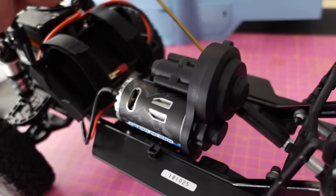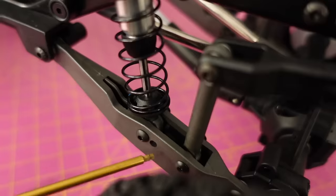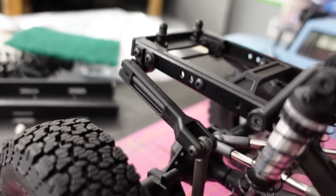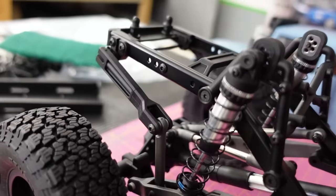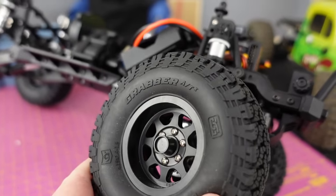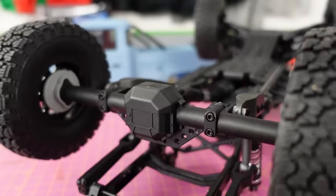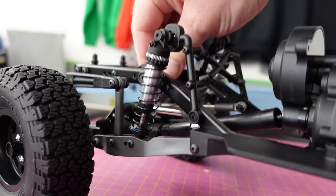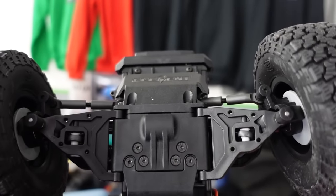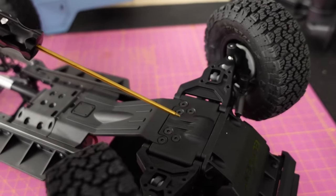You've got some small side steps here. There's your adjustable rear suspension — you've got a few different places you can put your suspension there, and a couple of different options on the trailing arms as well. And then there's your anti-roll bar or sway bar. General Grabber tyres on beadlocks. Foam's in there — compound's not super soft but still feels pretty decent. And then underneath: solid rear axle, your GKS Gatekeeper suspension, telescopic drive shafts, and then you've got that IFS2 which is really well set up.